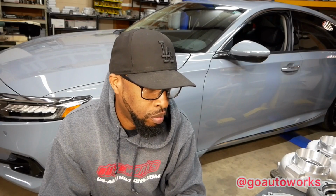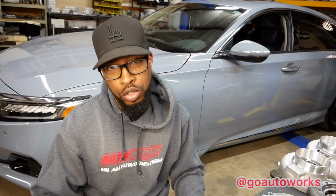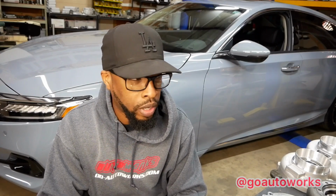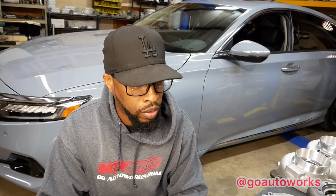So I've sold thousands of GT30s. They work great. They are great 250 to 450 horsepower turbos on a Honda application. Tried and true, never fail. So I can't say that there's a replica that's going to be equal to it without me using it and putting it through the ringer and it standing the test of time. The biggest thing with a turbo is, will it last? That is not something that you can say just by looking at it sitting on the table.